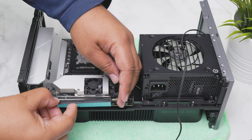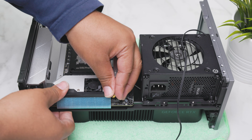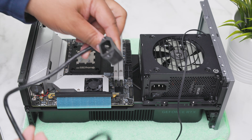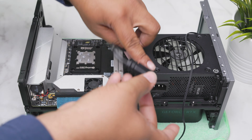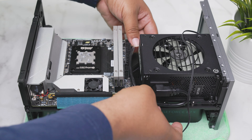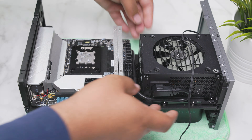The riser cable fits perfectly. It does require a small amount of handling to get it into the slot — I really love the way this cable looks. The T1 requires an extension cable that routes around the motherboard to connect to the PSU on the bottom. I like to run this cable first before adding any other cables like the 24-pin, because it will just get in the way. It helps if you pre-train the cable to stay close to the PSU so that there's no pinching.